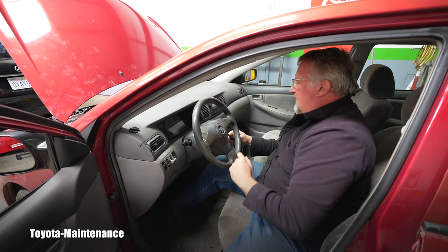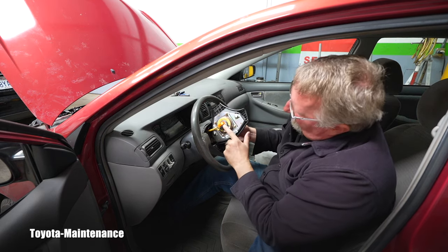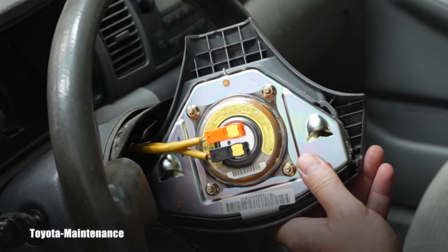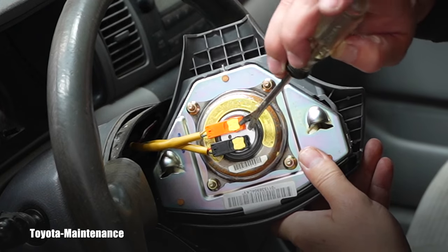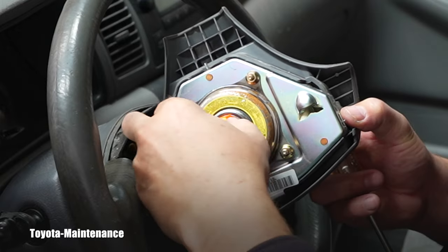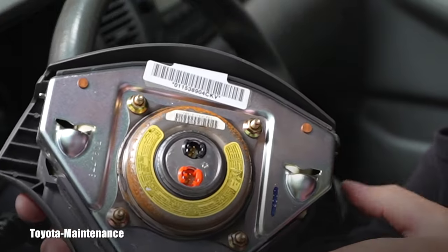This one was a little less torqued, so now you are able to lift the entire airbag pad out. Next is removing the two connectors — you can see them perfectly. You have to be very careful not to damage anything. It's about lifting these two tabs, prying them very carefully up. You heard a click, click — and now you can remove these two connectors away from the airbag.